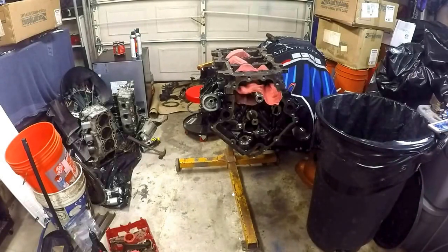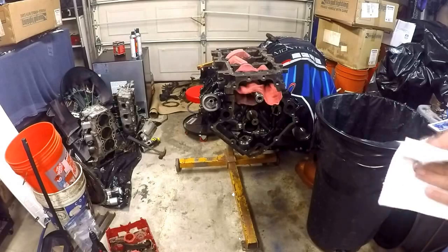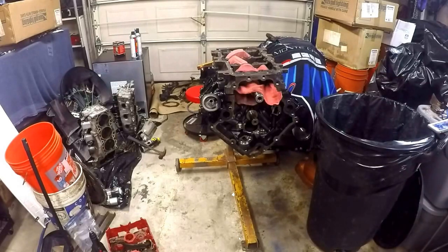My best guess today is that this engine was damaged previously — probably something like a dropped valve seat, which is kind of common on these little motors. I think it was then rebuilt, but they did not replace the valve that was on that particular failed valve seat. I think that valve may be the one that sheared off. There's no other reason for that valve to just shear — the valve seat hadn't dropped on that valve, which would cause torsional forces that might cause it to shear off. It simply sheared in operation, which tells me it probably had some previous damage applied to it.